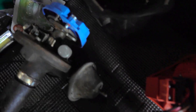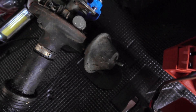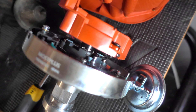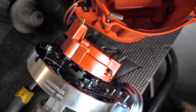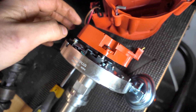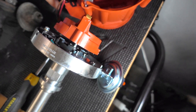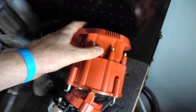If we look at the outside of the caps, they're very different — the Chevy one is way larger, so fitting internals from one into the other is just not going to happen. On the standard AMC distributor you have a little cam that opens your points; there's a similar cam inside the Chevy unit, which might cause some difficulty. The rotor looks like it might almost fit under the AMC cap, but it's just a little larger, so something with a smaller cap might actually work.